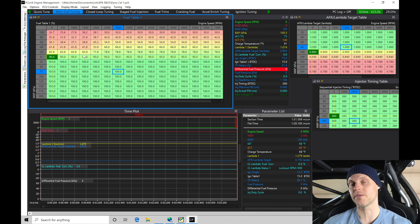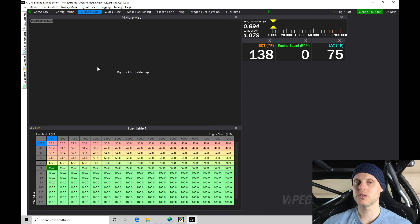Let's go back into main fuel tuning — focusing on fuel first, then spark timing. Once we get the fuel and spark timing optimized using our closed loop correction as close to zero percent as possible, we're going to go into our injection timing table at the very end of the video. This injection timing lets us vary the point where we're spraying fuel into the engine, and it's tremendously beneficial below 4,000 RPM — we can gain efficiency and fuel economy by getting that optimization point correct. Rather than only using Megalog Viewer as mentioned in the last video, I want to use the mixture map, which is a built-in histogram right in our software that lets us collect driving data and use it to update our main fuel table.